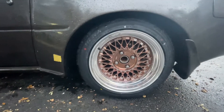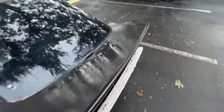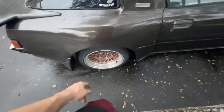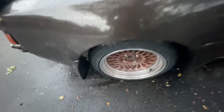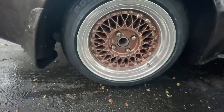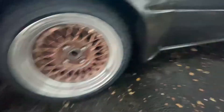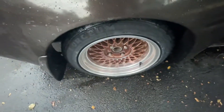Had an issue on this side when I was putting the wheels on. I converted these to studs — they're like allen-head extended studs. I put them in and then cut the ends off because they were too long. Then when I was loosening one of the lug nuts on the adapter for the other wheels, it pulled all the threads out of the hub with the spacer.